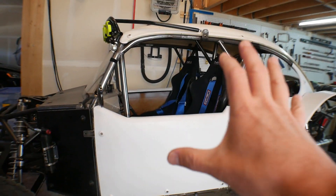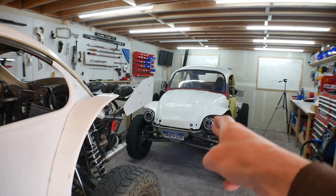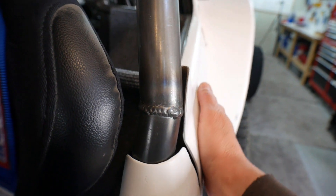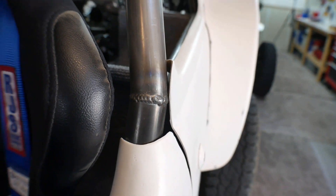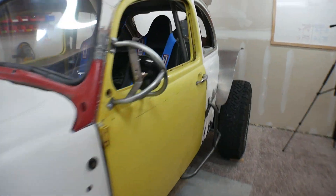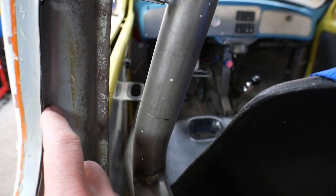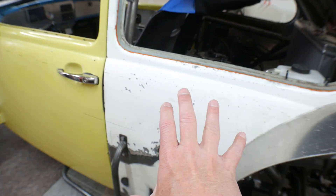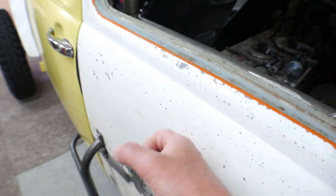The first thing is: this is the Ratchet chassis right here. This chassis, although it was designed off of a traditional Volkswagen Baja bug, it's meant to be built with either fiberglass panels or steel panels. The chassis goes all the way out to the exterior of the skin. Whereas on a regular Volkswagen bug you'd have interior panels — the exterior panel is what the Ratchet chassis is designed to mount to. On a regular Volkswagen body you also have the inside, so if you were going to use a steel body, theoretically you'd have to cut all of those inside pieces out and just use the exterior skin.